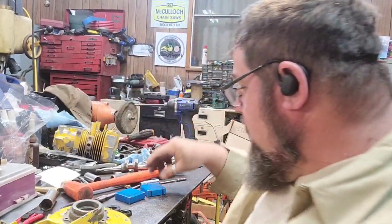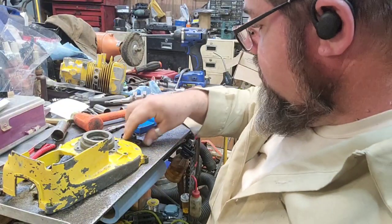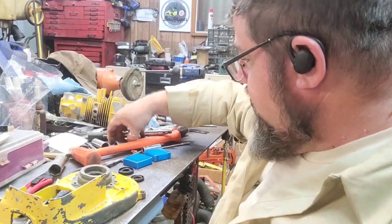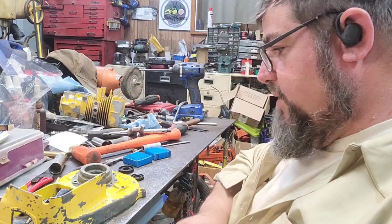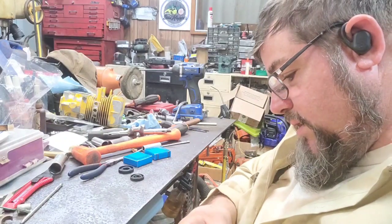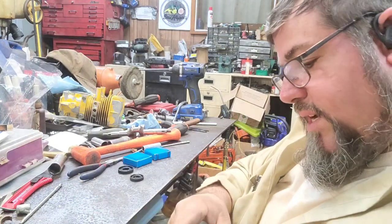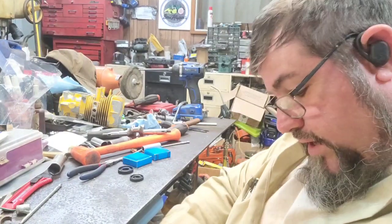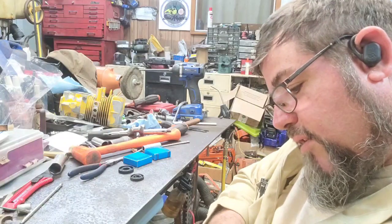Now we're back. We made it to the bearing place - we got some bearings and some seals. These seals are the closest thing we can get; they're rubber clad instead of steel. So we are going to put a little bit of sealer on them as we drive them in - that way they'll have a little extra holding power. I usually don't tell people to put sealer on their seals, but on these we're going to because there's a little bit of discoloration in this magnesium and it's old. I'm just going to smear it a little bit right around the inside of the hole - just a small amount, it ain't got to be a whole lot.